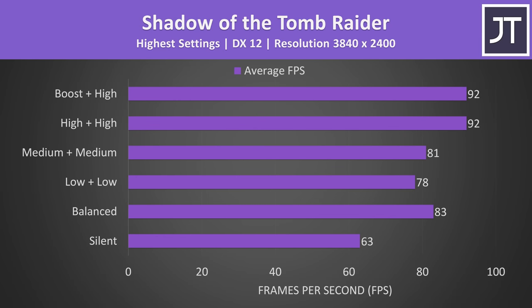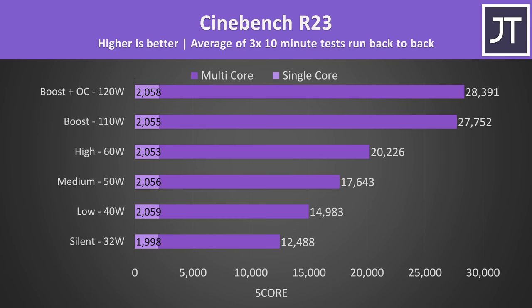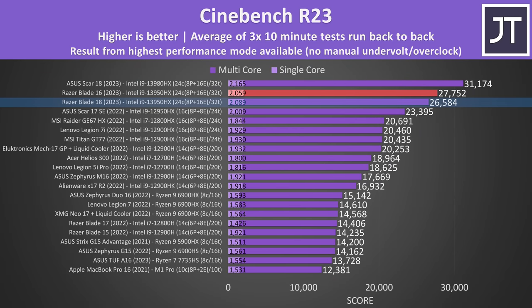Max settings at the native 3840 by 2400 resolution puts this higher than 4K, and it's still running fine. The CPU can boost much higher with the GPU idle, like in Cinebench. I've also tested with the overclock option enabled with power sliders maxed out and a minus 0.05v undervolt applied, but it only gave a small 2% boost in multicore. It starts off running at 160 watts but thermal throttled down to 120 watts at 101 degrees Celsius. Interestingly it's scoring more than a thousand points higher compared to the larger Blade 18 with the same CPU, though in terms of percent the smaller Blade 16 is just 4% higher.